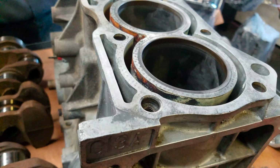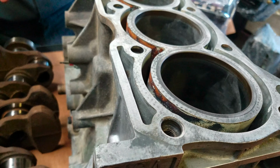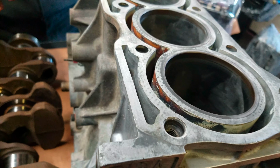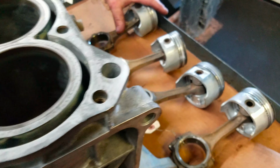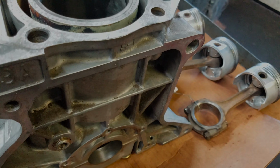You know, I'm sure budget's always in mind. Yeah, but it's not necessarily a determining factor. I wasn't buying top of the line. Right. So since we have to buy pistons, I would not put new pistons on a used bore. Yeah. Okay. So yeah, we're gonna bore it.